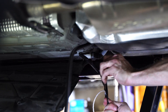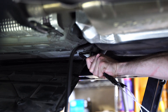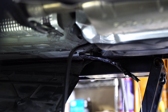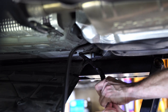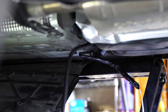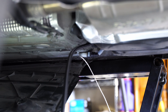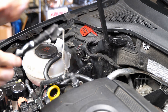Here's the tip I have for you: instead of trying to drag that new fuel line all the way through with the old fuel line, I'm going to drag string — some heavy duty construction string. I'm just taping it to that fuel line, and then I'm going to pull the fuel line from the engine compartment and it's going to pull that string with it, so I'll end up with string in that channel. The reason I'm using string instead of just pulling the fuel line through directly is because it is such a tight fit — it's so easy to get hung up on things, and it's so easy for the tape joining two lines to come apart. I've seen many videos where people tried that and it just doesn't work out. So I'm starting with something different — pulling string through — and I just pull from the front until the string comes through both ends of that fuel rail.